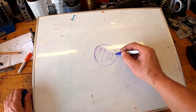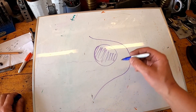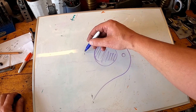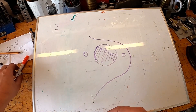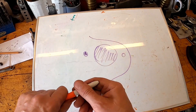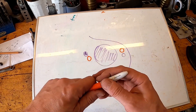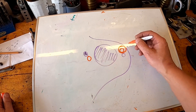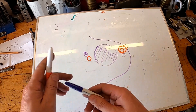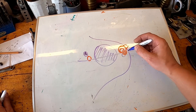In the pictures it's kind of hard to see, but this is the exhaust port here. The original area comes off the head like this — there's supposed to be a flange hole here and a flange hole here. What happened is the previous owner filled in one flange hole, made a new one here, then made another here. This is the hole that got over-drilled, popping through the casting. Really, neither of them got the alignment correct — the hole should have been here.